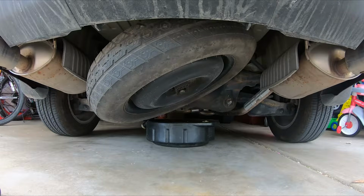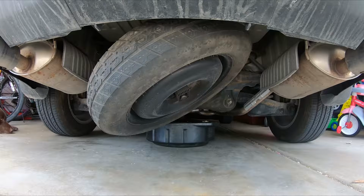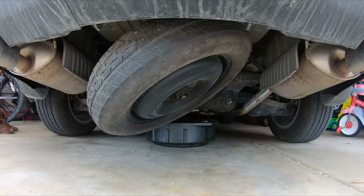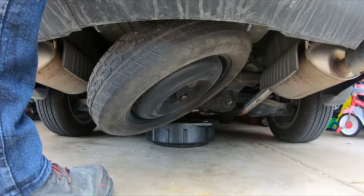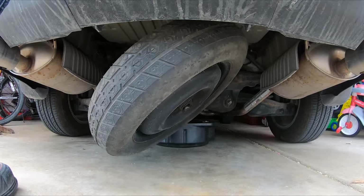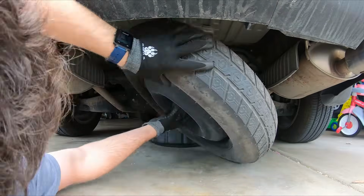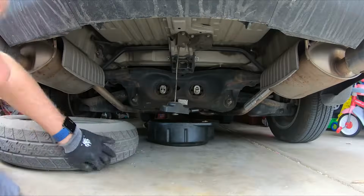So after all of that, there's a lot of stress on the rear differential, and the pump that controls the wet clutches started to make some noise. So I went ahead and bought the Honda VTM fluid and changed it out. That fluid's like 30 bucks for a gallon, and you use like 3 quarts or so. So not a big deal, and it only takes 15-20 minutes to change it out. You do have to lower the spare tire to get it out of the way, but pretty easy overall.